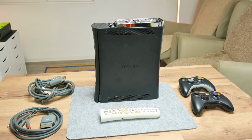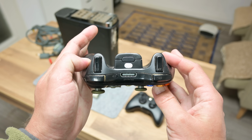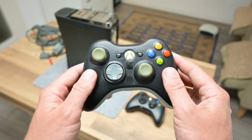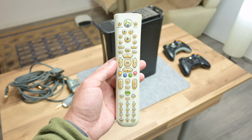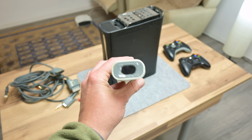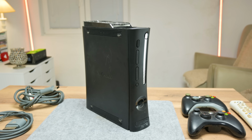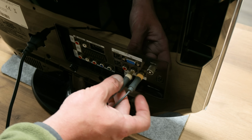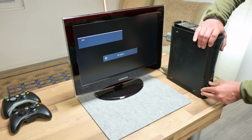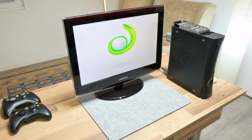The Xbox is in bad shape from the outside. It's almost half disassembled, and some small parts and plastics are missing. I was told that this Xbox has 3 red LEDs on startup, which mostly means there is some hardware problem. First, I checked the Xbox visually, and later I connected the Xbox to the monitor, and I used my own power supply that I trust, and the Xbox started normally, which I didn't expect at all.